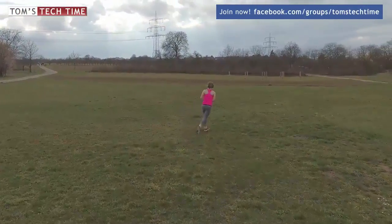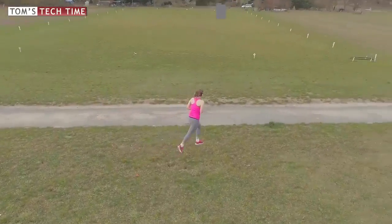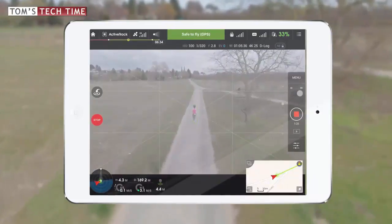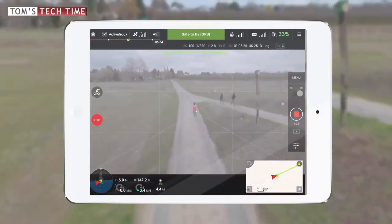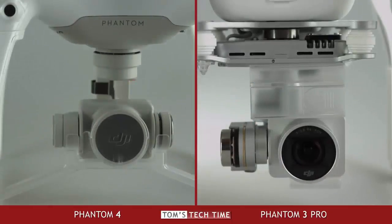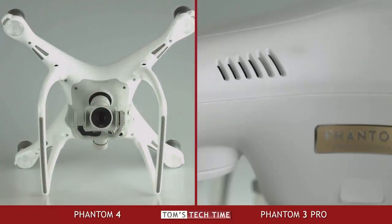Next, let me show you ActiveTrack. Drag a box around a person or object you want to follow, a green box pops up, tap go, and the Phantom automatically starts following that person — you need neither a GPS tracker, nor a phone, nor a remote controller. The Phantom 4 followed her around 100% autonomously. It didn't get confused by other people walking by, and it even navigated safely around thin branches. When turning around, the Phantom kept her in focus at all times, and as it raised its height slightly, the movement looked even smoother. Filmmakers with a low budget will love ActiveTrack — no third-party software on the Phantom 3 can replace this function due to missing obstacle sensors. Finally, DJI came up with an easy-to-put-on gimbal saver, and they moved the ventilation openings from the top of the arms on the Phantom 3 to the bottom on the Phantom 4, which prevents moisture from entering the body.